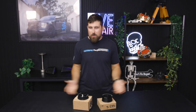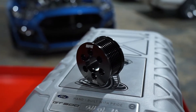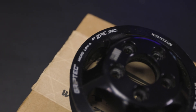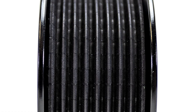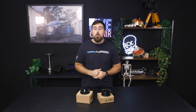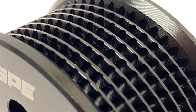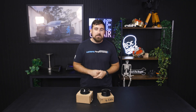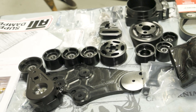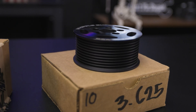So it's basically losing your boost in arguably the worst possible spot — right at the end of your power band. Is there a way to fix it? Yes, we have a few solutions from a few different manufacturers including pulleys from Griptek, SPE Motorsport, and of course Whipple's 10-rib upgrade kit, which are all designed to help eliminate belt slip. Griptek's pulleys are designed specifically with machined grooves inside the pulley that go the reverse way of the serpentine belt in order to grip that belt even more than a standard pulley — they work extremely well and it's what we use on all of our supercharger builds. SPE Motorsports also makes a pulley that does a similar effect of grabbing that serpentine belt and helping it grip the pulley a bit better. You can also upgrade the entire serpentine belt system on a race application to a 10-rib system, which gives you more contact on the supercharger pulley and more grip.